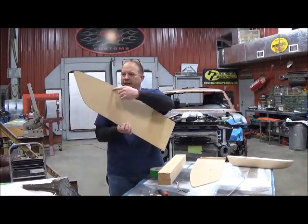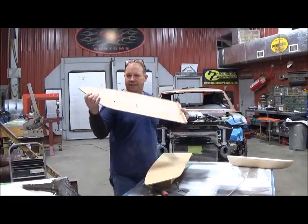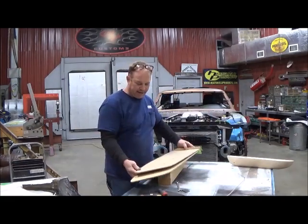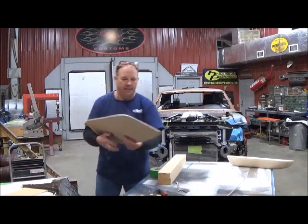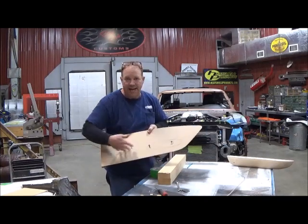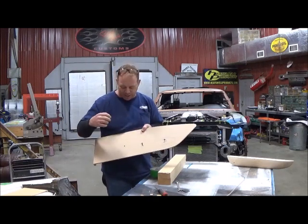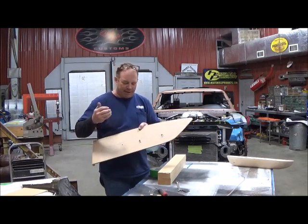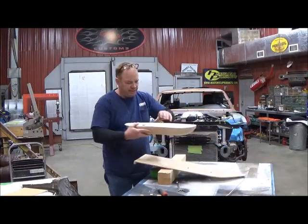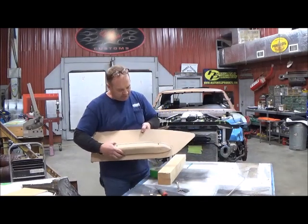This is one I'm fixing to cut right through there — that's my mark and that's how much I'm gonna remove for the other door panel. I cut it down to this size. I wanted to use some of these body lines so I drew out what this looked like and cut the piece of wood down to shape it like this. There's a lot going on — it's got to have a pull handle, power window switches, an armrest at the height of the seat, and be able to be wrapped. This is what I came up with and I think it turned out pretty nice.